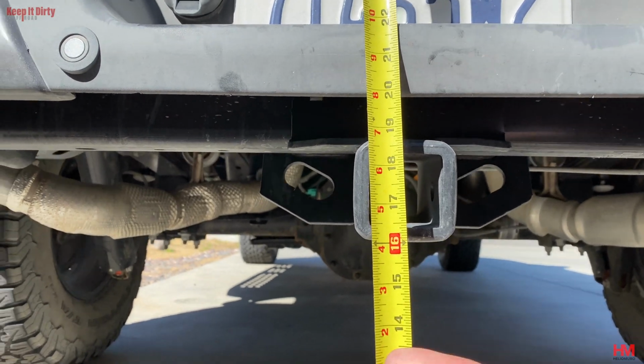There's also the extra gear we're going to carry. We have camera gear, drones, water, all the food we carry, plus our asses in there. So we're definitely going to look at doing the springs here pretty soon, but I'm not going to do the springs till I have a plan up front. If you watch my other videos, don't upgrade the back unless you plan on doing something up front to match. So we're going to be doing springs up front, and I think this time we may try the iBox springs. They're linear, they're different. We're not going to be keeping them long, but it may be good to try those out, see how they perform, and give you guys a review on that as well.